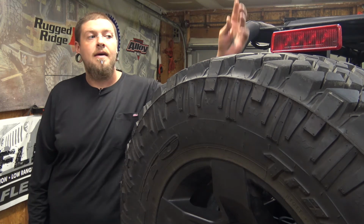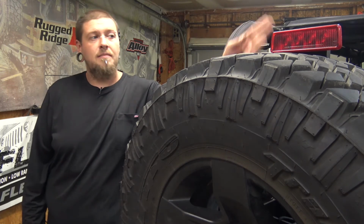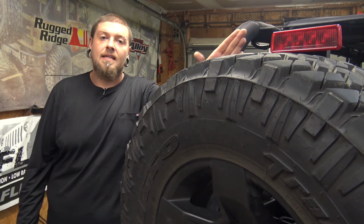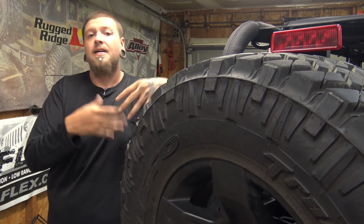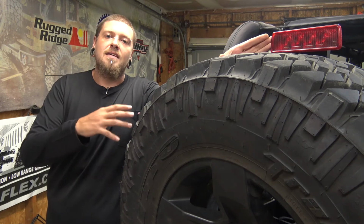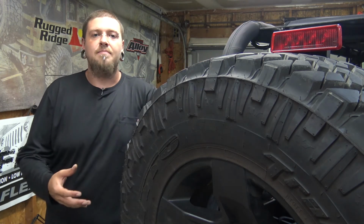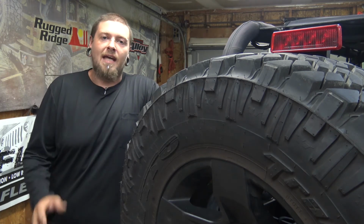Like I said, this could be used on a multitude of different vehicles. I just chose Project Dirty Willy, as I said at the beginning, because the factory third brake light here is LED. That's one thing you want to make sure, that you're wiring this to an LED. If you wire this to an incandescent bulb, it's going to flash so fast that most likely you're just going to blow the little filament out of the bulb. So you'll just keep blowing bulbs. So this is designed for LEDs, and it doesn't really have the amperage rating for regular incandescent bulbs. It's for small little lights, so I wouldn't try hooking this to your light bar or anything like that. So, you know, when you flip it on, it flashes and stuff like that. It wouldn't handle that kind of power.